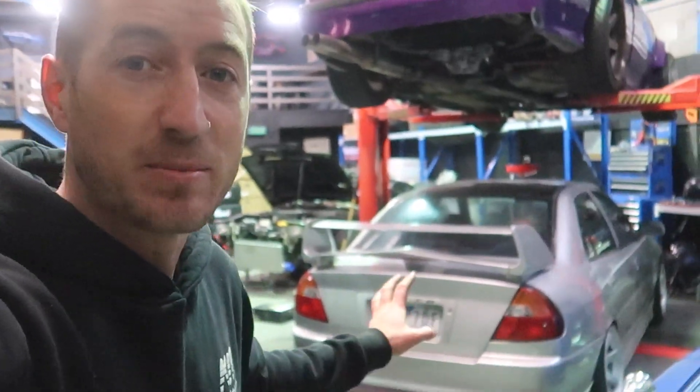I just spent the last 20 minutes bleeding the brakes to get them to work so we can take it for a drive, even though it's dark outside now. I just wanted to take you guys for a drive because you deserve it. I literally can't get a single bit of brake feel - I've bled the brakes, there isn't any air in the lines, I've got one of the self-bleeder things, used almost a whole container of brake fluid, and I have zero brake feel. When I start the car it goes straight to the floor. Maybe you guys can chime in on that in the comments, because I have no idea.